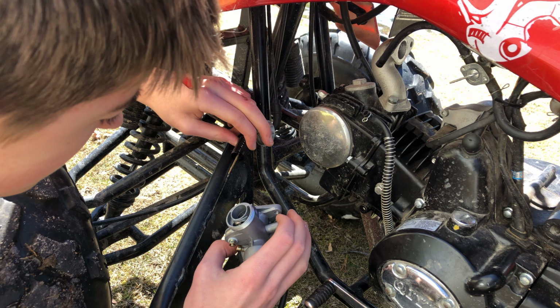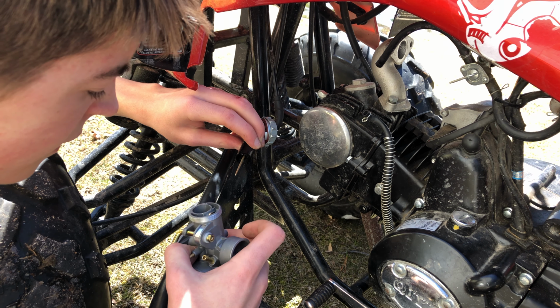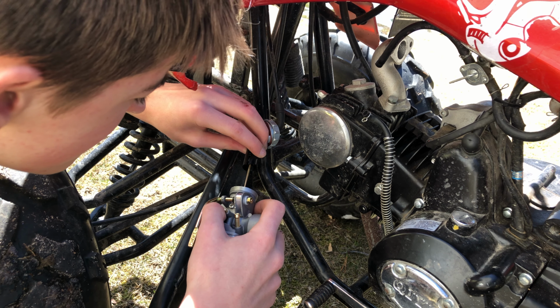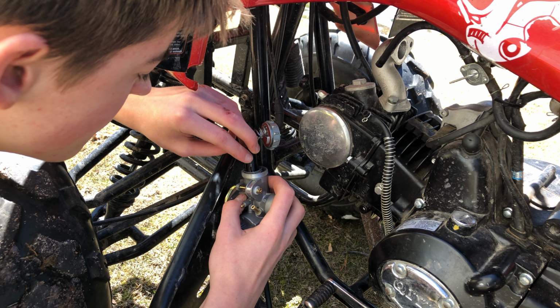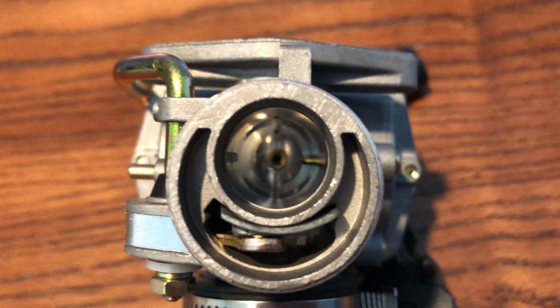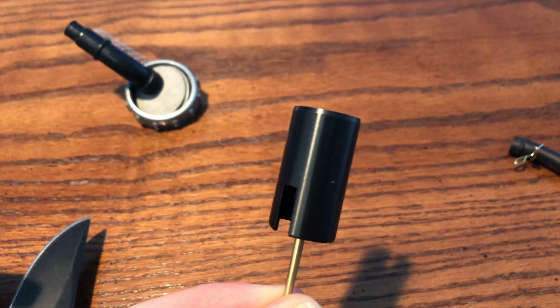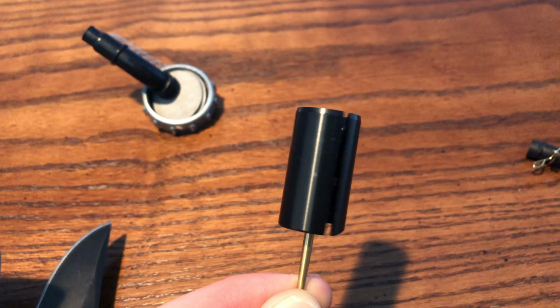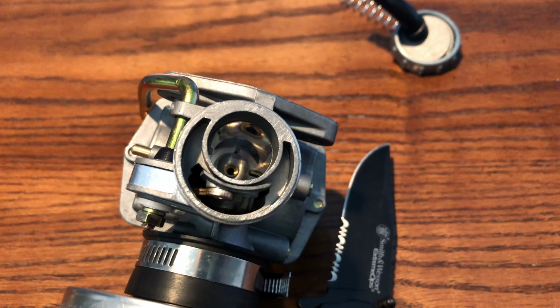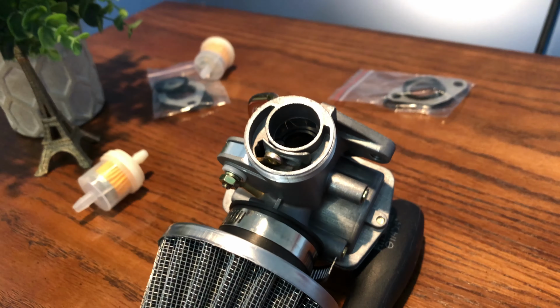First, you should install the gas mechanism. It's very important you get the metal cylinder lined up with the pins or it will not go back together correctly. Take note of the inside of the carburetor's shaft. You should see two small metal pins, one larger than the other. The larger pin is going to slide along the larger opening in the cylinder. This is the same for the smaller pin as well. Also be sure that the pin fits into the bottom of the shaft, as you should see in this picture.